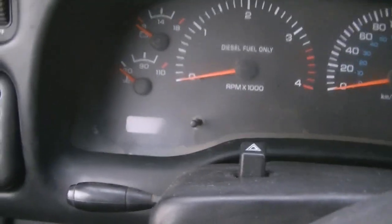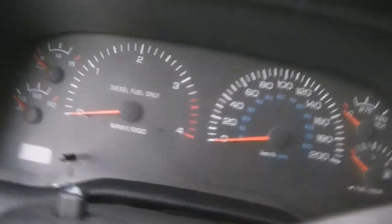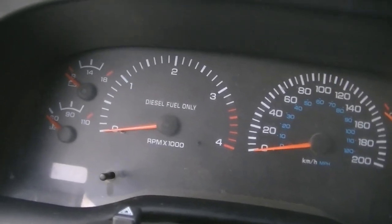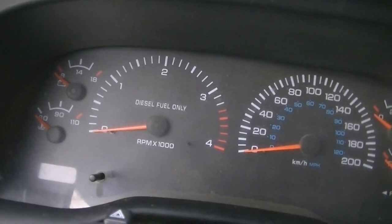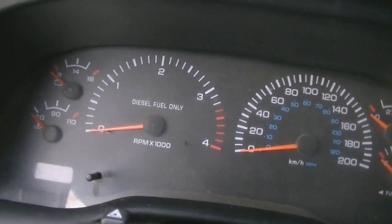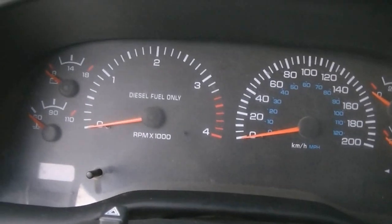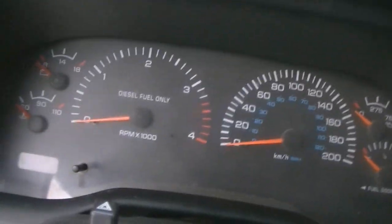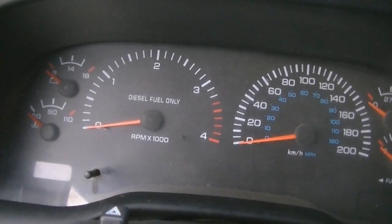I had the Cummins going to run it in because it's getting a little nippy out here. I had it just about up to temperature using that little device to hold the RPMs at 1500 for maybe 15 to 20 minutes. Then when I went back to idle it kind of sounded like I had a bit of a miss. I want to see if it does it again — it kind of alarmed me. I don't want to deal with any issues with this motor.